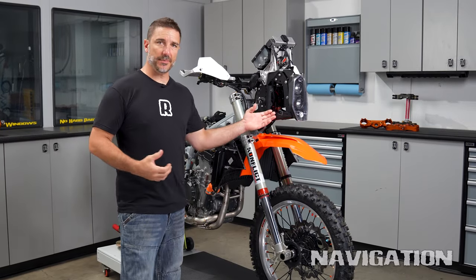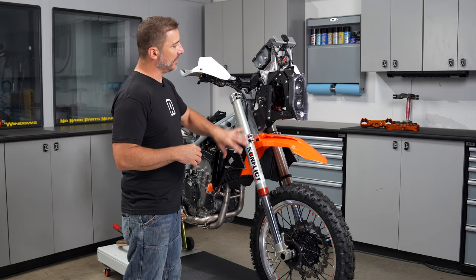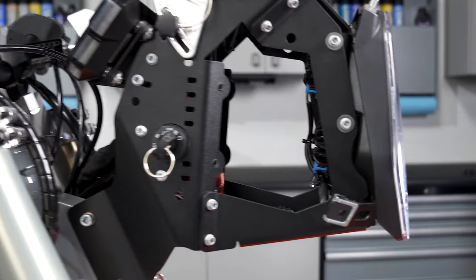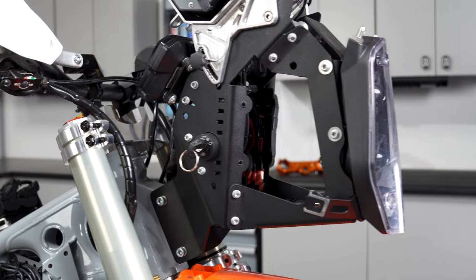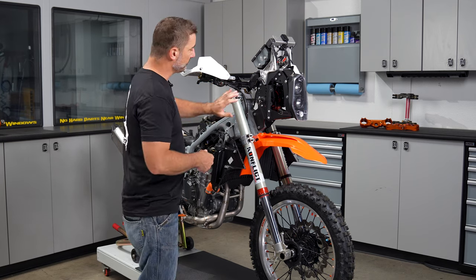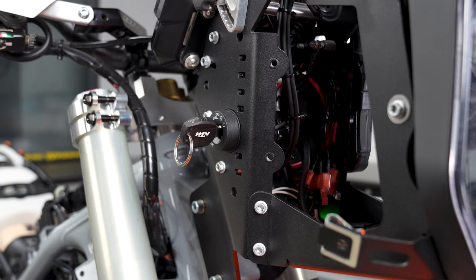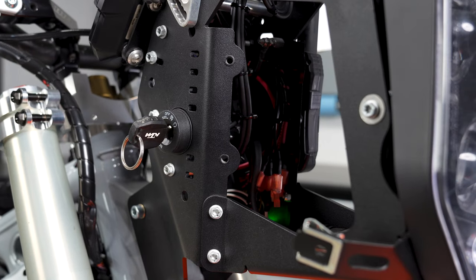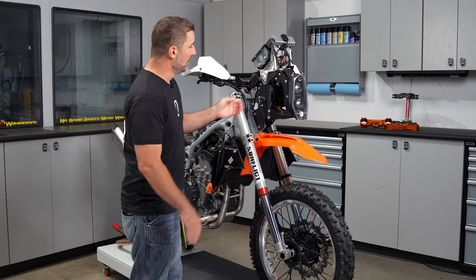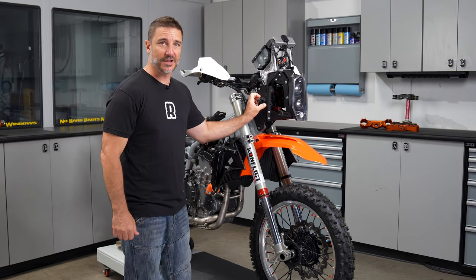Let's get into navigation. We use a Rebel X rally tower — really good builds, been really happy with these. We do a couple of special things with them. These are available to the public; you can buy the whole kit including the KTM light. We modified this Rebel X tower for our uses in racing. One thing you'll notice is we stuck the key in a different spot — because we're running our billet triple clamps, we're able to put the key wherever we want. We modified the side of the tower to put the key there, but found out the hard way that you have to have the key chip exposed, or you'll have a key failure and can't start the bike. We had to machine out a hole so the key comes out far enough for the chip to be recognized.